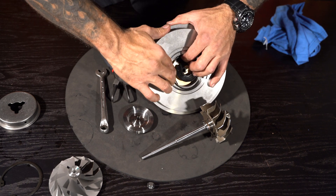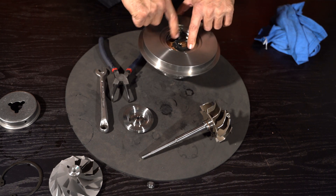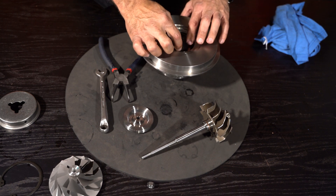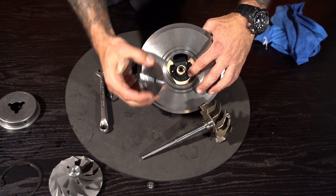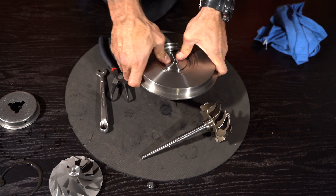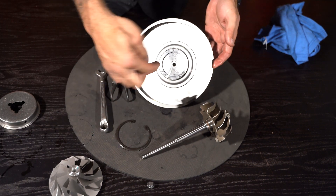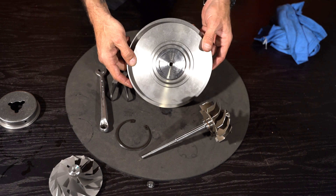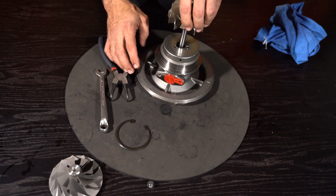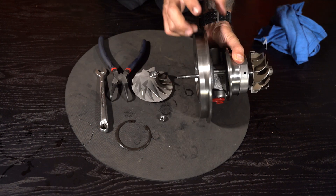The o-ring then gets put into its groove. Once the o-ring is in place, put the oil deflector back in. There's your o-ring. There's your steel insert, which goes back in there. Your circlip will obviously fit inside holding everything in place — I'm not going to put it in now because I haven't put the little retaining clip back onto the journal bearing. Then you would put your heat shield on, your shaft would go through, and obviously the compressor wheel on the other side with the shaft nut, basically clamping everything together.